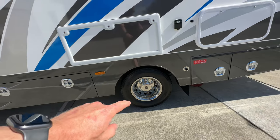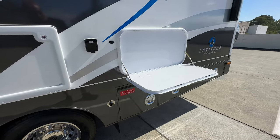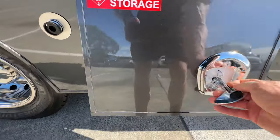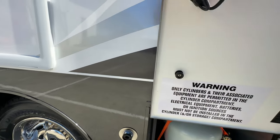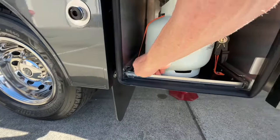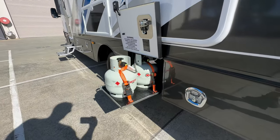You've got the nice standstill covers for the wheels, an outside power point, and a fold-down table. Gas bottles — you've got two fours. The biggest user of gas in these is actually your hot water system, though you use a bit for cooking as well. With the instant hot water you can have a 20 or 30 minute shower if you like. Obviously that'll use a little bit of gas but the convenience is very nice. It just comes out on a slide for easy access.